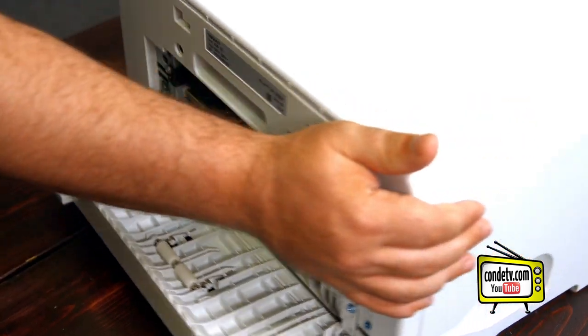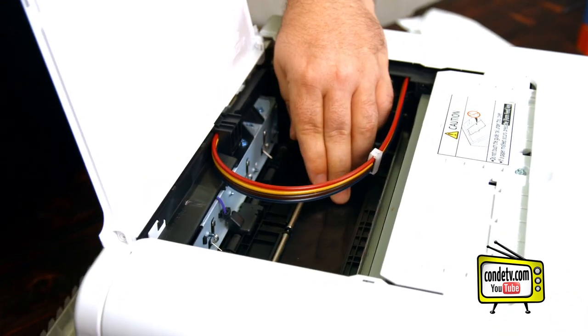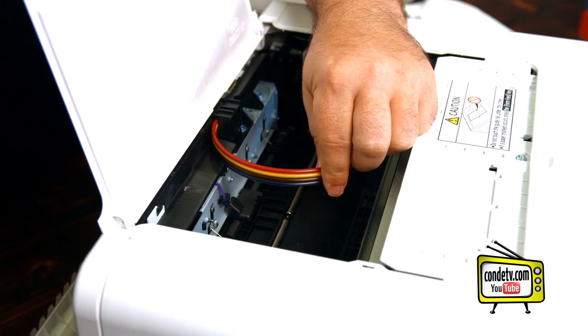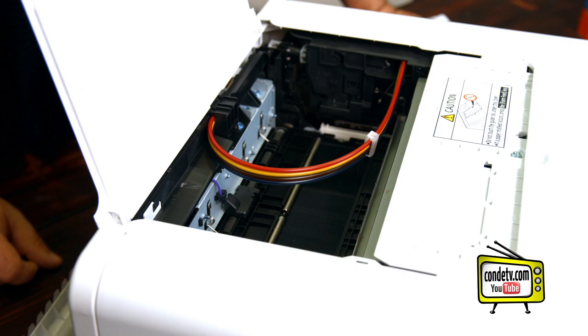From there, you're going to open up the top of the printer. And this is where you're going to find the feed belt. You do want to be careful of these hoses here that run along from the cartridges to the printhead, not to mess with those. And you also want to make sure your power is unplugged so you don't have any accidents.